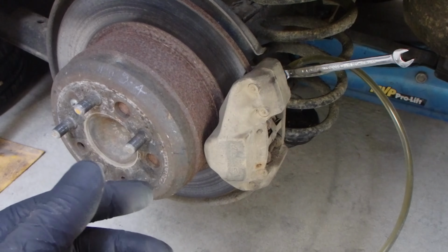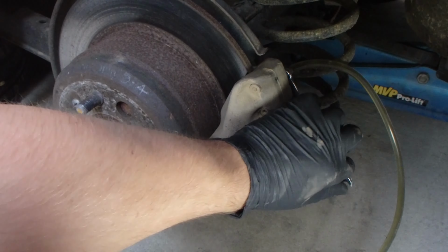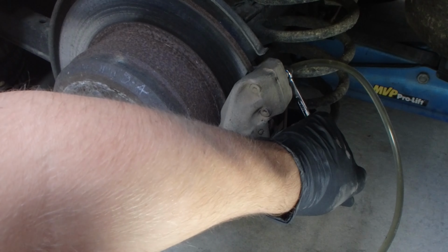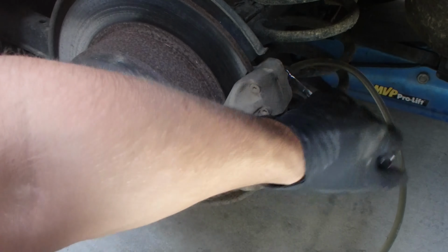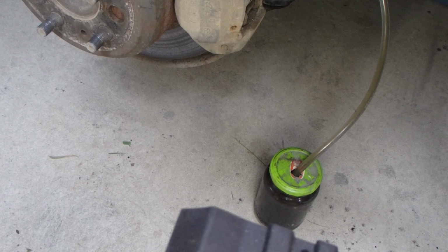So now I've taken a bit of fluid out of the hose here. I'm just going to double check up the front to make sure there's still plenty in there, and then we'll keep going. Rightio, now we're all filled up again at the front, so ready to do some more. Down, and up, down, up, and stay up. We'll touch it again. Now my little bleeder's all totally full, so we'll empty that out and start again.